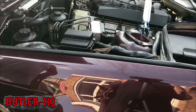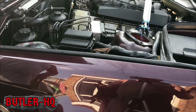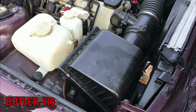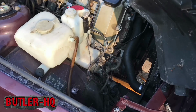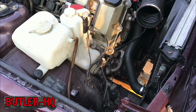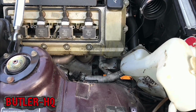But please be careful when you do this because you're shifting the weight of the car. So have a look around what I'm doing, get your mate to have a look around, get your mum to have a look around, your girlfriend, while you're jacking it up, just to make sure the car's still sitting on its axle stands. And only lift it up just enough so it gives you better access to the top mounting bolts. If I remember correctly, you have to remove the airbox to get to the driver's side engine mount. And I'm going to take the water bottles out just to make the job that bit easier. And doing those two small things shortens this job down quite a bit.